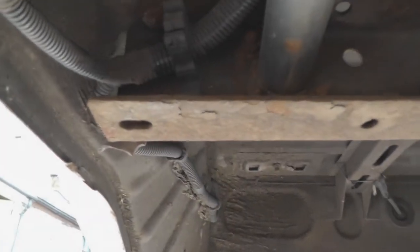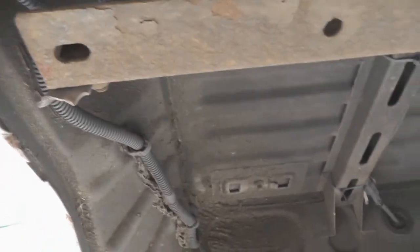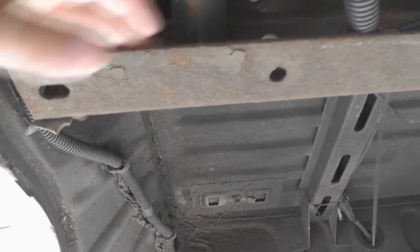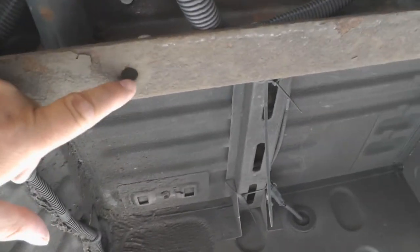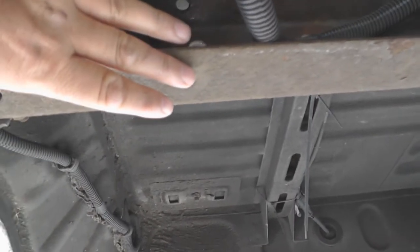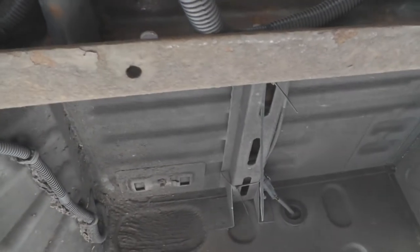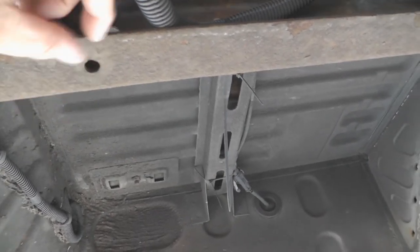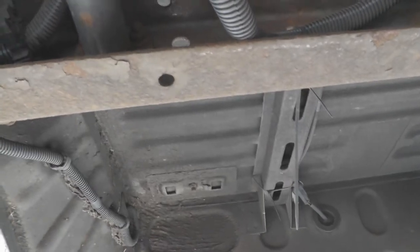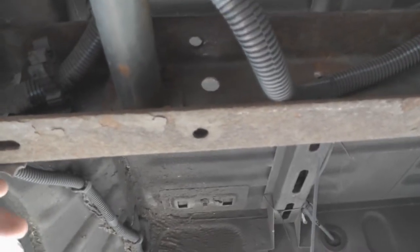This is underneath the van. That's the two holes there where the tow bar attaches to. And what I've done is I've marked that with a bit of paper, so I've got my spacing exactly right. Like when you do a grave rubbing, I just put some paper up, rubbed it, got the markers there, and then offered it up to the tow bar, so I haven't got to move anything around.